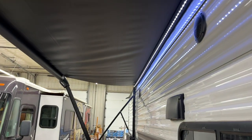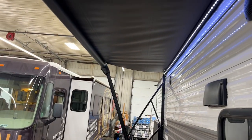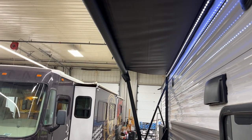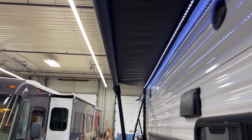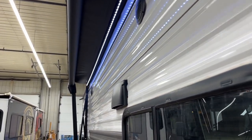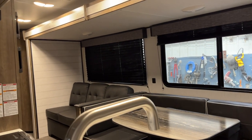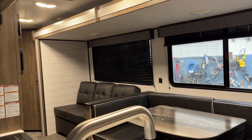Come back inside and press and hold retract — the awning will make its way back in. Just watch to make sure the fabric stays on top. Keep in mind the awning catches a lot of wind — once you get to about 15-20 kilometers per hour wind, bring it back in so you don't bend the arms. Down here, press and hold out and the slide will make its way out. Once the slide is fully extended, you'll hear some clicks on the motors letting you know they've reached their stall point.